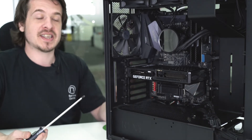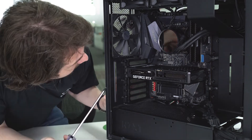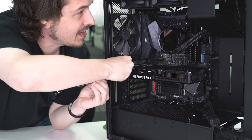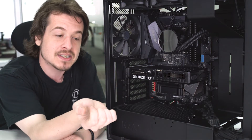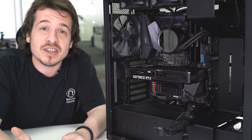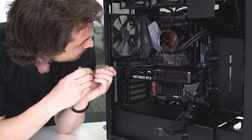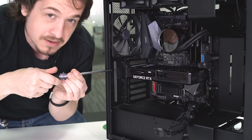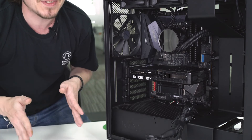The next thing is that this graphics card is screwed in on the PCI. What I have here is my favorite little Phillips head screwdriver — pretty much the one tool you need to build a PC — and I'm just going to remove these two screws. You can work with this flat on the table if you'd like; it is certainly easier to see everything. The problem is these PCI screws from some brands are rather heavy and easy to drop. If you drop one on the motherboard, it's never going to be good. So I like to work vertically, so that if my screwdriver loses magnetization and something falls, it falls away from the delicate components — onto the chassis or case or top of the power supply.